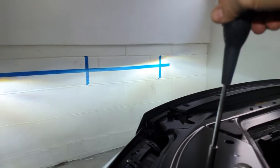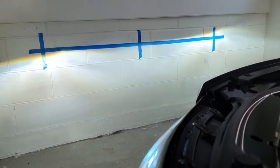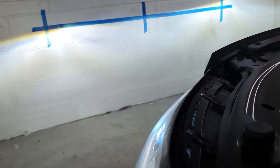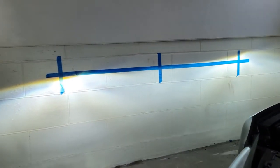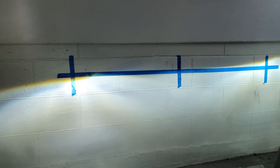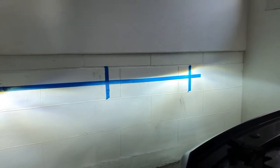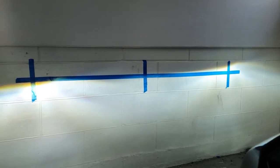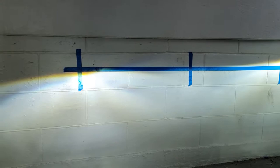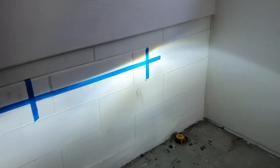As you can see it's going slowly up — turn it. We turn that one and the light is going up. It should be aligned — yeah, almost there. Usually the right side should be a little bit higher, because the left side should be lower so when another car is coming against you, you don't blind the other driver.